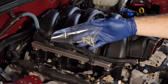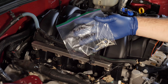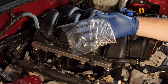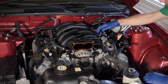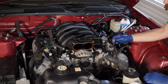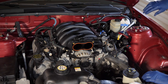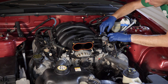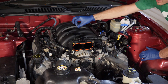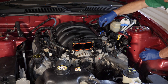Like we talked about in part one, ensure that you are indexing all of the nuts and bolts that you're removing from the motor. For instance, I put 'fuel rails' on a bag and put all of the studs from the fuel rail in that bag. Now if you didn't watch part one, I did go ahead and remove all of the electrical connectors for the fuel injectors in that video, so that step's already been done. Now that we have everything disconnected, we're going to remove these as one assembly — both sides at once because it's connected in the center — and we're going to make sure we have a nice clean place to set them down once we have them off.